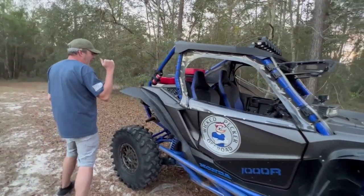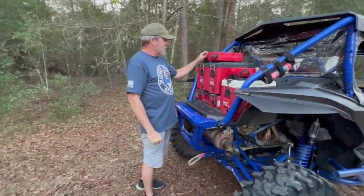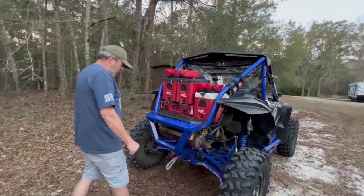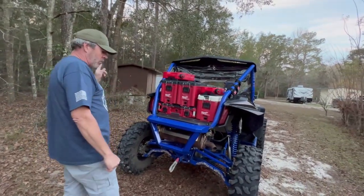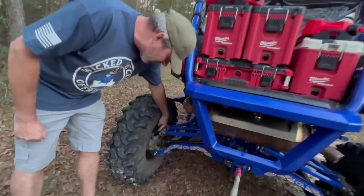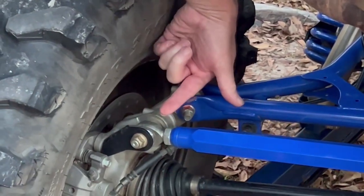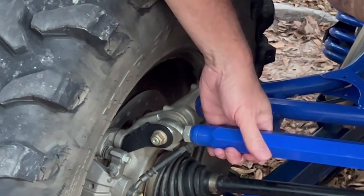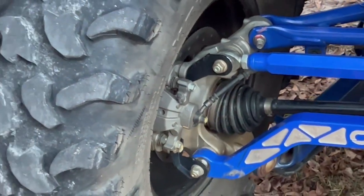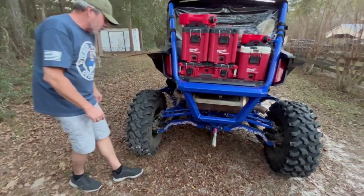The Wicked Pecker pack-out fuel can mounts — you can order with just the plastic base plate or with the basic aluminum mount. Fits one, two, or three-gallon RotopaX cans. Also the double shear brackets for the rear radius rods from Bosman Designs — the factory mounting is single shear, which is pretty weak. The double shear brackets are not that expensive and double the strength. Highly recommend those for peace of mind.